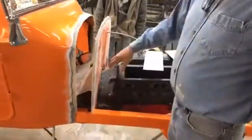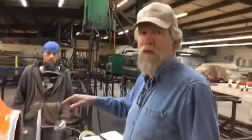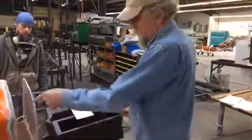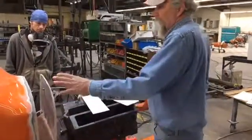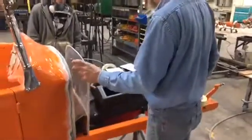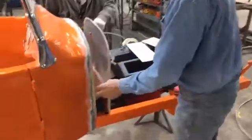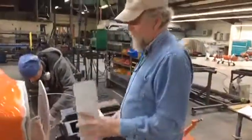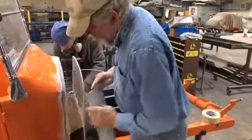We're going to change out the transmission to a 700 R4, and I didn't realize, but this must have had a 400 in it because the trans mount is for a 400. So we've got our jig here, know where our motor is, and we need to make 4 inches between here and here. This body had a little flange on it here, so when it was together, you could put a hood on it. So what we're going to do, I've cut 2 pieces, and I've cut them actually 4 3/4 inches because I want 4 inches between here, and I'm going to overlap it a little bit.